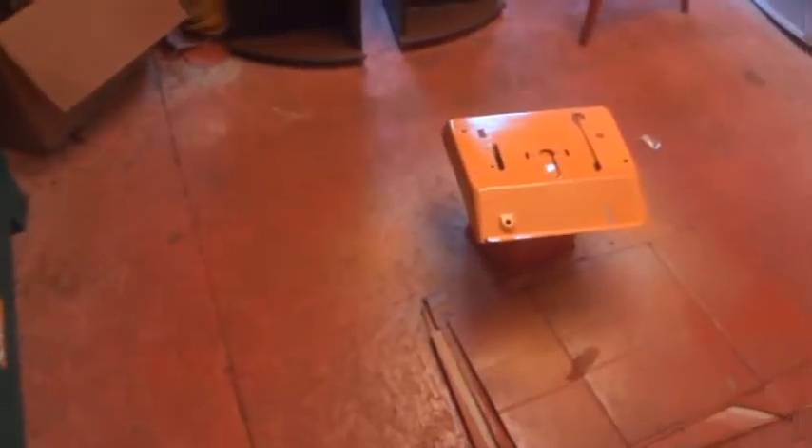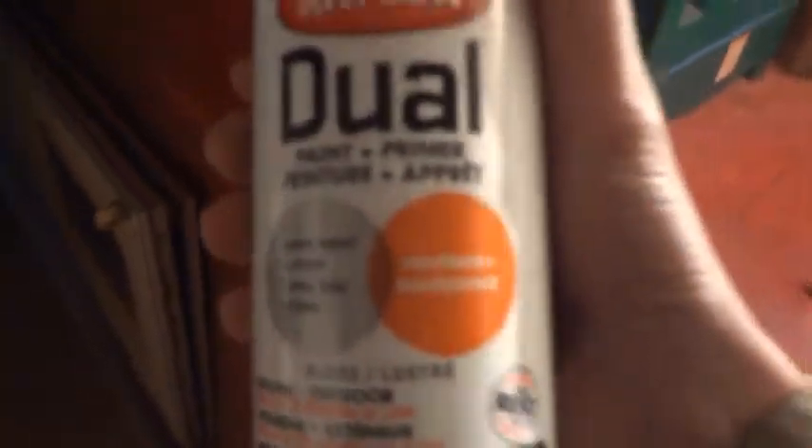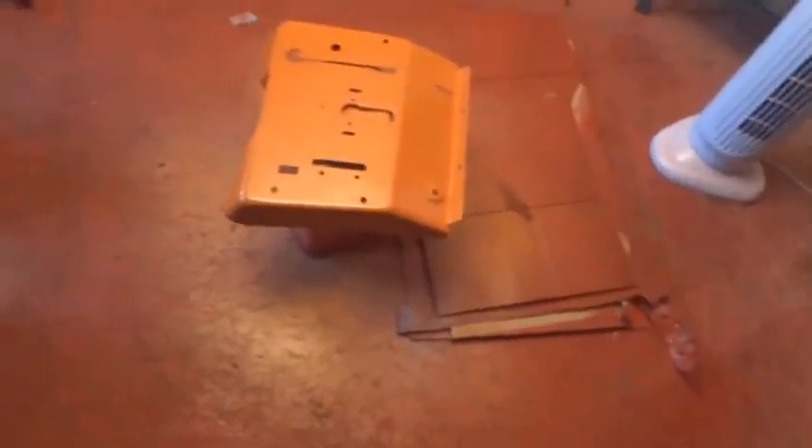Hey guys, MoMachineBuilds, back out here painting. I'm just showing you that I painted up my dash orange with Mangin orange Crown paint. It's like seven bucks a can here in Canada. What I did was I wire brushed all the rust and used something that's supposed to take off paint and rust, then sanded it with 320 grit and sprayed it.